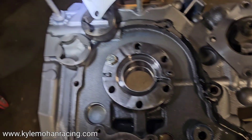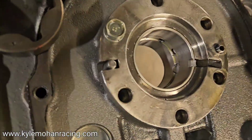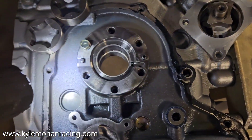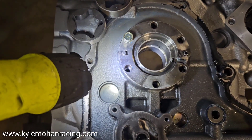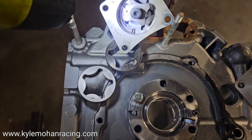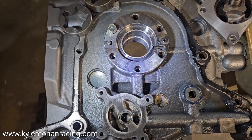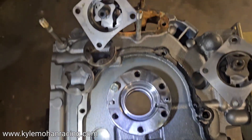Although this one came in with an NA pump, we're going to upgrade to a turbo pump so it can see a little bit more volume. The bearing wear looked pretty good — it's got multi-window bearings. So what would have been a non-multi-window-bearing motor with sharp edges and a small pump becomes a late-mod gear, multi-window, high-volume oil-delivery motor. It's able to deliver that oil volume because you upgrade to a Turbo 2 pump, and then the system's able to regulate pressure because I'd recommend running an increased pressure regulator and also shimming the regulator in the front cover — that'll have to be a follow-up video on oil pressure regulators.